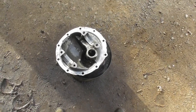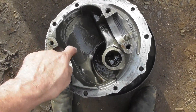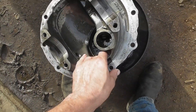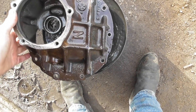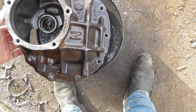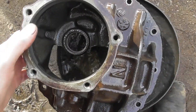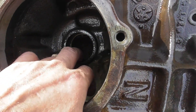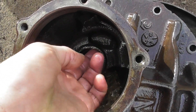Now I start cleaning up the case. It's kind of one of those odd 9-inch Fords — it ain't got the red stuff in there, the Glyptol or whatever they put in them. Sprayed it down with some penetrating oil so it wouldn't rust — it's humid as heck here. Anyway, it's got that bearing out down in there. I was hoping that since it was moving forward it wasn't spinning around and eating the case out, and it doesn't feel bad.